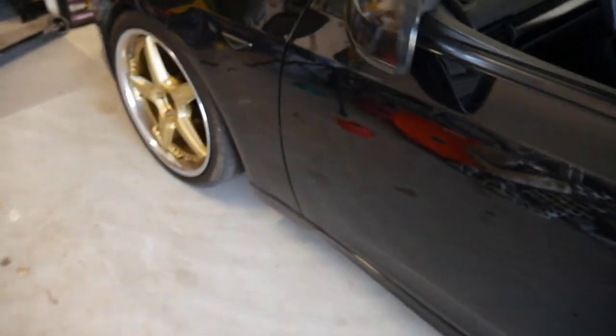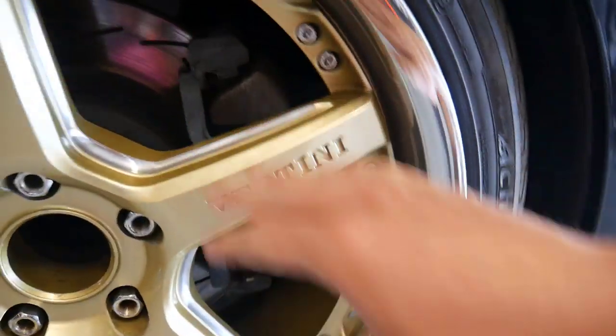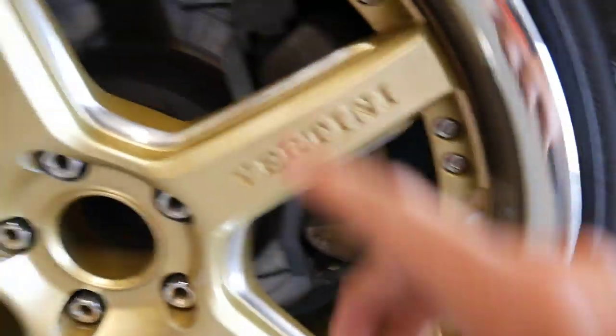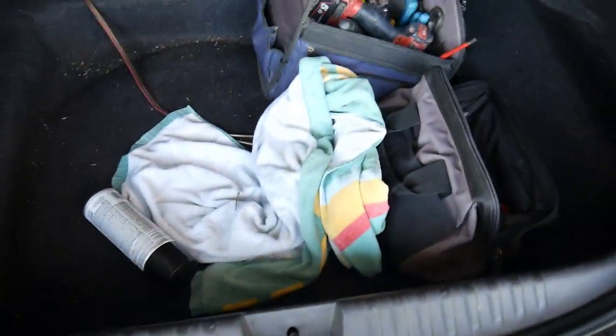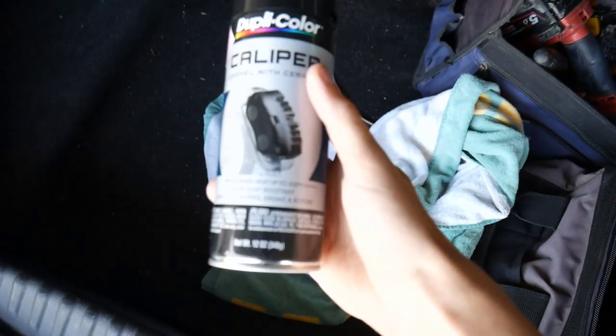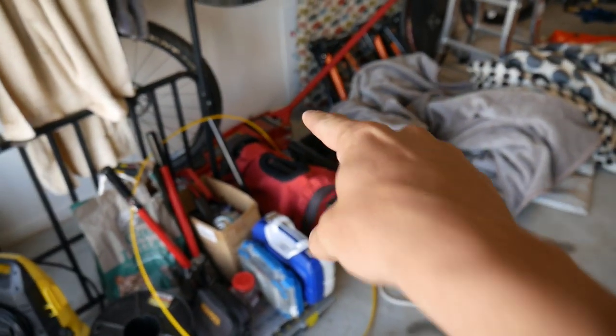Same with the fronts — I'll redo pretty much just the front calipers, paint them black quickly, wrap some garbage bags around them and then we should be okay. So we'll go and do that first, let's get to it. I've got the stuff in the boot, I've just moved the car inside. We need some black caliper paint, and the jack over there.